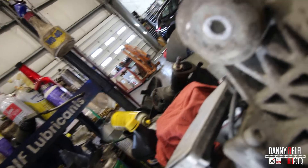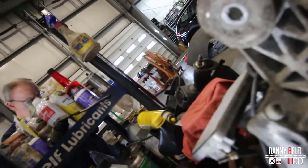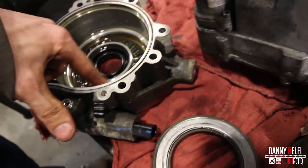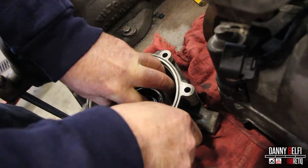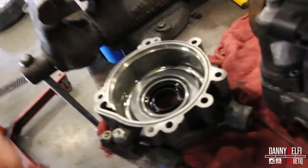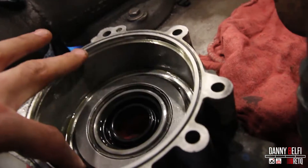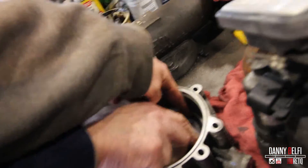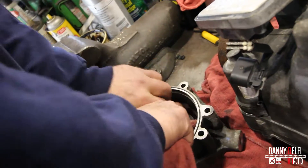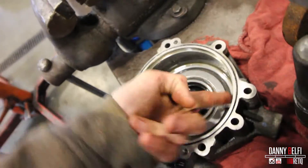I use Vaseline when I do trannies - when you have trouble getting it in, that's the way. Covering this with oil - that's good. It'll try to slide down, there's gotta be a chamfer on it but there's not really a chamfer on it, so it's gotta go in easy. Blow it out again to make sure it's in there right. It's high on this corner - go around here and you can feel the lip change. In there now - in there perfectly.